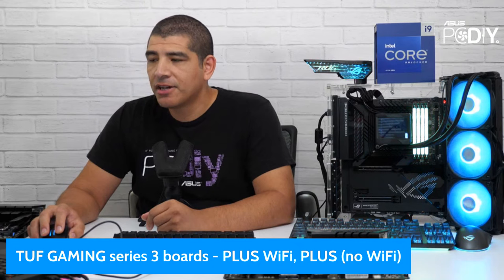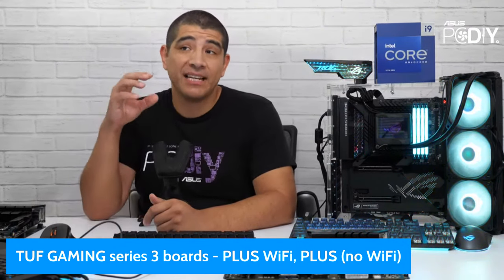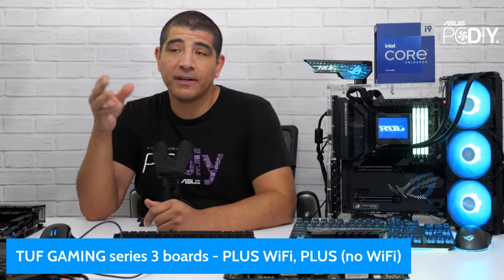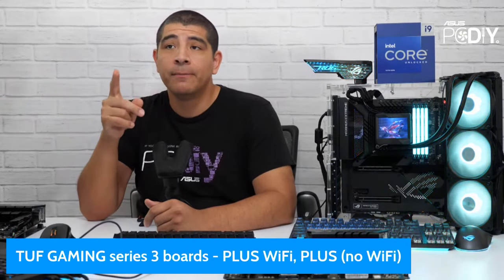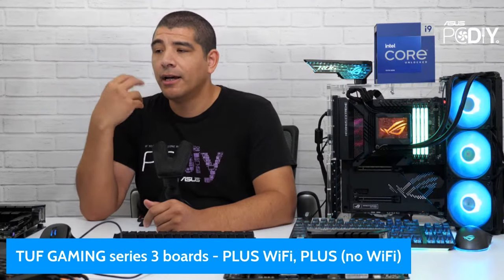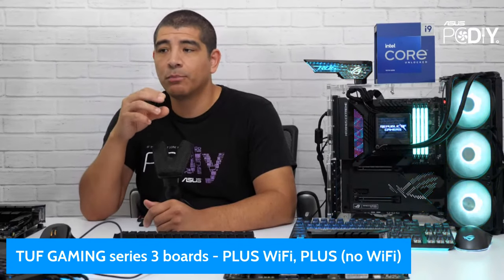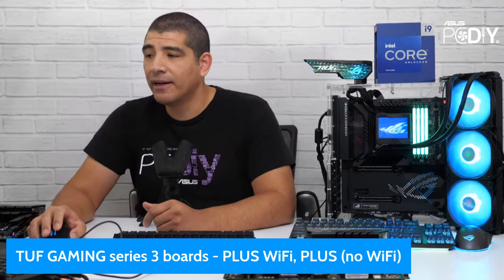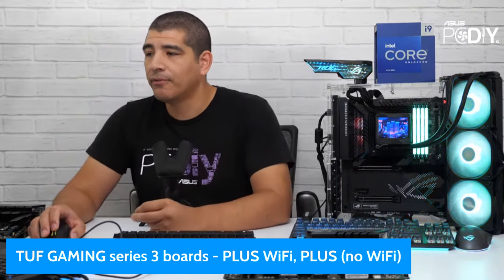Braytheon is commenting about Bluetooth performance. Bluetooth performance is outstanding for the latest generation, Bluetooth 5 and up to 5.3, which is going to be on the latest Wi-Fi 6E based controllers, and even on Wi-Fi 6, which would still be Bluetooth 5.2. But many users forget that you always need to connect the antenna. Without the antenna, you will significantly lower the overall stability and throughput performance for Bluetooth. Although Bluetooth is not as contingent on bandwidth as Wi-Fi is, do make sure to connect those antennas if you want the best Bluetooth performance.